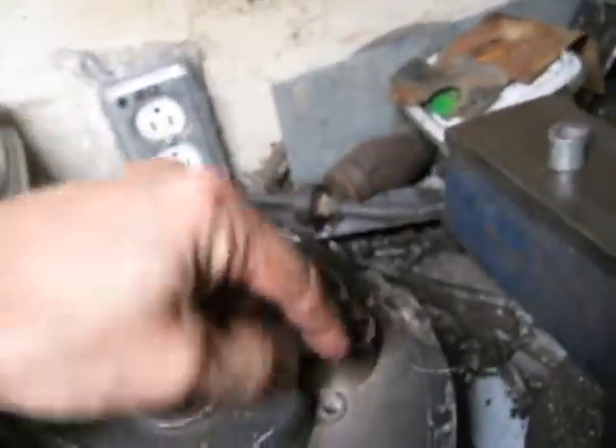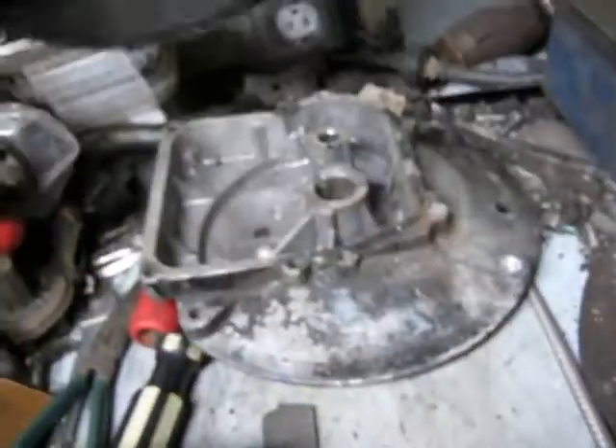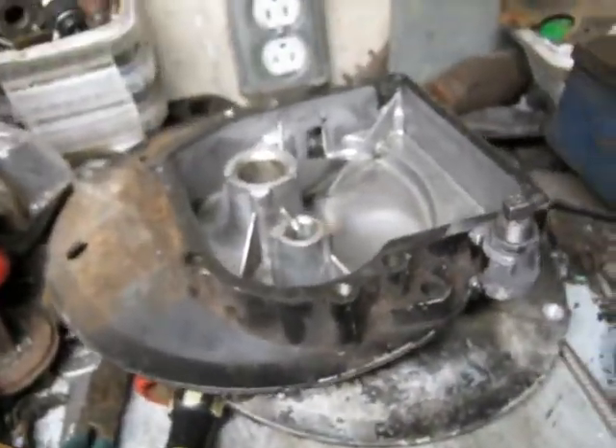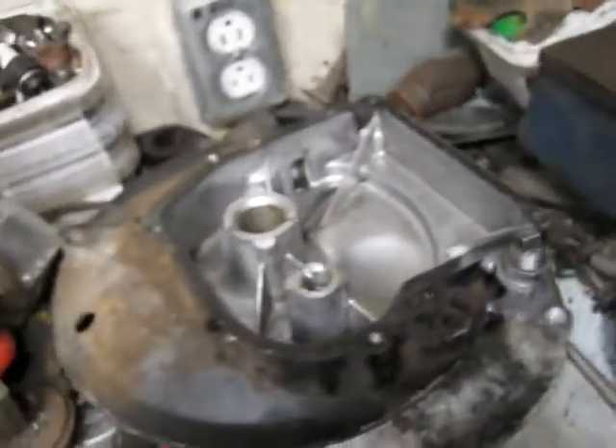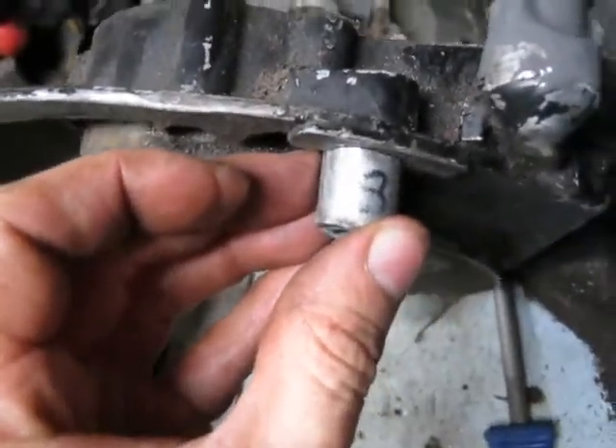On the occasional engine I've gone in through the back or something. Anyway, the other thing I'm doing different on this one — normally I cut my cardboard base out in this shape and then drop the engines in and it bolts right down onto the plywood. But seeing that I've got to do it for 5 engines here, that's an awful lot of complicated jigsaw cutting — it takes a long time, you've got to be pretty accurate, or the engine won't fit. So what I'm doing instead is making these washers so the engines will stand up on top of these little tech washers, and I'll only have to drill a few holes for the crankshafts and probably the oil plug.